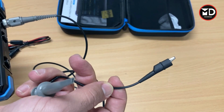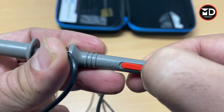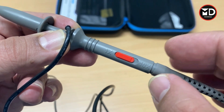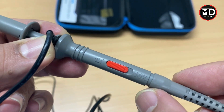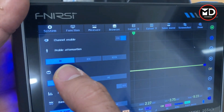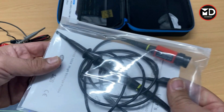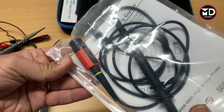On the other end of the probe you have the tip to catch the signal, and this clip goes to a good ground. On the probe itself you have 1x or 10x attenuation. If you're checking circuits with high voltage, you use the attenuation to control the amount of voltage going into the oscilloscope. The 10x setting minimizes the voltage 10 times. If you put the probe on 10x, you also need to adjust it in the channel settings — you have 1x, 10x, and 100x options. For 100x you can buy the high voltage probe separately, which provides 100-to-1 attenuation.